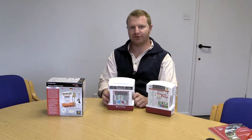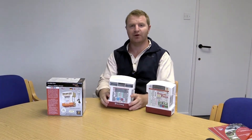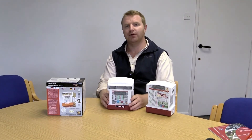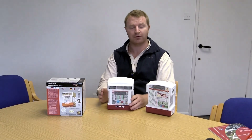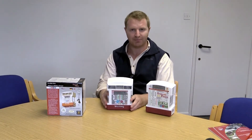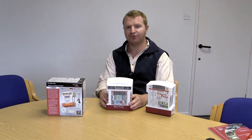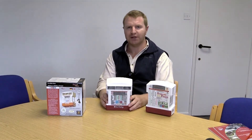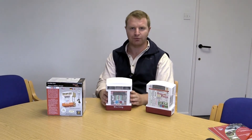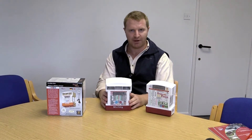As this unit does current limit, you have no fear of running an appliance off your appliance batteries whilst driving along, because the maximum current that can flow through this 60A unit on the 12V side is approximately 60 amps. If you are looking at the 24V, 36V, or 48V model that current might go up to 70 amps, but generally speaking you cannot draw any more current through this unit than about 60 to 70 amps, which is absolutely ideal. Often people might be running large appliances from their appliance batteries whilst the engine is running and draw a lot of current down their relay system — it might blow fuses, it might weld the arc of the relay shut. It could cause a lot of damage in the DC circuitry. So by having this installed you can limit the current to a known amount so you can set your fuses accordingly.